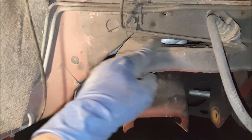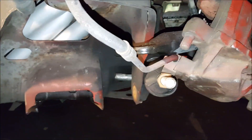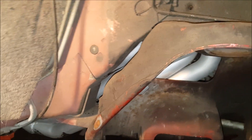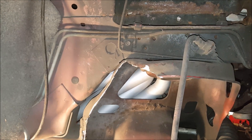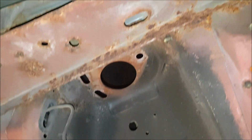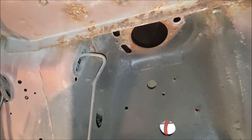The first thing we're going to cut is we're going to make some relief in the subframe — this part is beefed up to support the spring which would normally go here, but there's no spring here so it's not really going to hurt to take material away. We're just going to cut a chunk out right here. Here's the trimmed and recessed front subframe — this should give me clearance for more steering angle. Next thing to trim is this little shelf here, which will give space for the strut to travel once it's pushed out further and allow you to have camber back for the wheels.